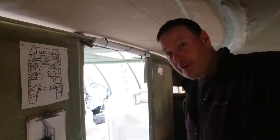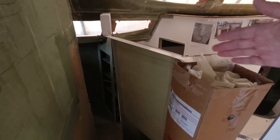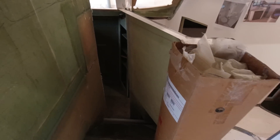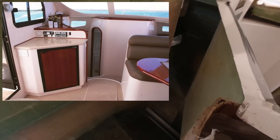I've had a pretty massive session over the last couple of days. I've got the bulkheads in, and you can see I've left a small depression where I've filled in between the chamfer on this bulkhead and the chamfer on this one — laminated and tied it back. It's smooth, absolutely perfect. It was a jigsaw puzzle — in fact two pieces had to go in separately and then be glassed together — but it's come up really nice. I'll be able to work on the cupboards and robes as part of this back module, tying in more foam core panels and building the strength back in. It's taken a good two days to get it totally complete.